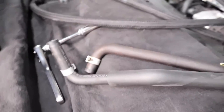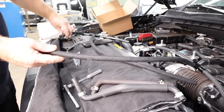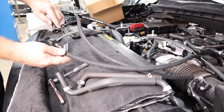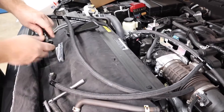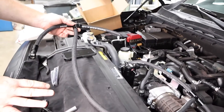When you look at your instructions, you'll see that you have one hose with a 45-degree angle fitting and one hose with a straight fitting. Your 45-degree angle is going to be the driver's side PCV hose — this connects to the valve covers only. The other side is your vacuum hose — this connects to your intake manifold only.